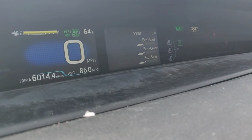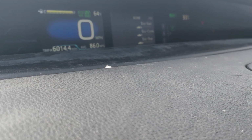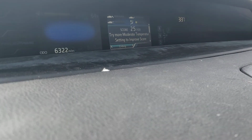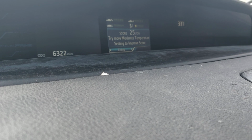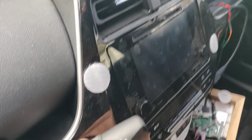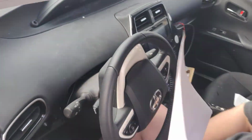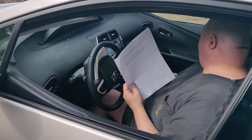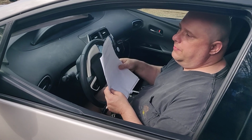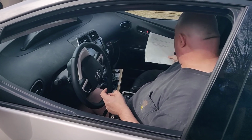Okay, now the key is on, the onboard key is active, and when I hit the stop, now the onboard key is not active. Also, this button is disabled now. This button will not become active again. I mean, even if I press the brake, it's dead. This button does not become active again until I hit that button, and then it only becomes active for about 30 seconds, which is adjustable. So all of those things add tremendous extra security to the car.